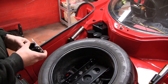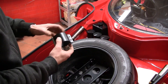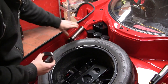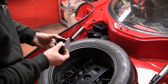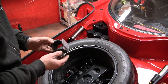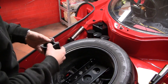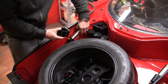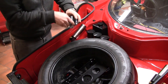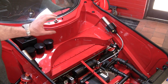The last thing we need to do up the front here is actually mount our external damper reservoirs. I've got a whole bunch of these — they're spotlight mounts for bull bars, but they happen to be the right diameter to match our reservoirs. I've already modified this one. I was pretty sure the reservoirs were going to live up here somewhere, so I've machined off the tag that was originally used to mount it and welded this little bracket on. That will fit up in here something like that, and I think we'll just drill and tap into that chassis rail and it should be done.